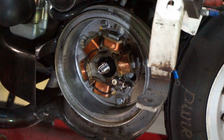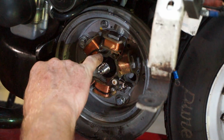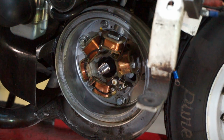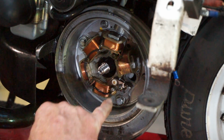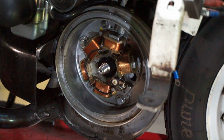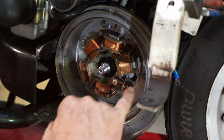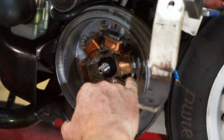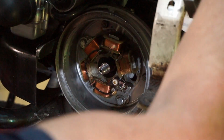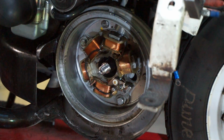Okay, that's cracked it off. Let's have a look, see. Oh yeah, absolutely bone dry. The pad's not even up against the cam. So that would have closed up the points fairly quick. It looks like somebody has been in, they've put brand new points on. That's odd. Where's the bloody condenser? No condenser. Have they running an external condenser? Maybe. Let's follow the route. That's extremely odd.